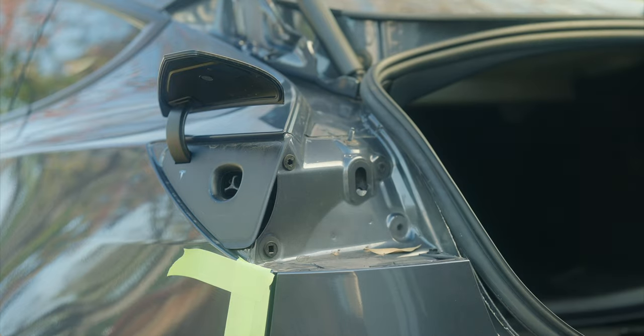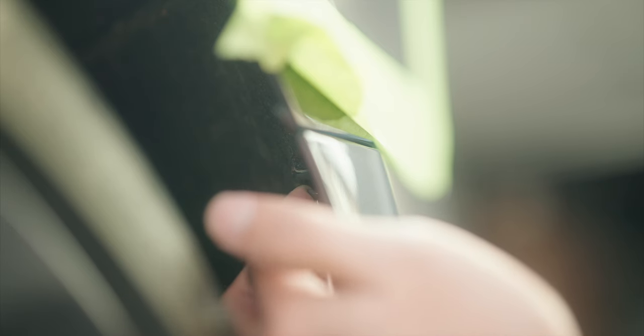There are just 2 screws left and some fender clips holding the rear bumper in place. Use a Torx 25 to remove 1 screw from each rear fender well. Finally, remove 3 clips that hold on the fender liner on both the driver and passenger side rear fender wells.